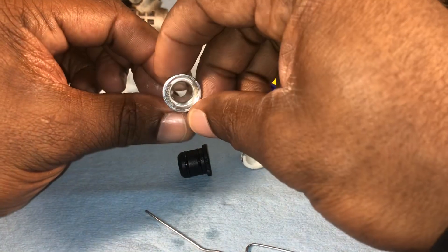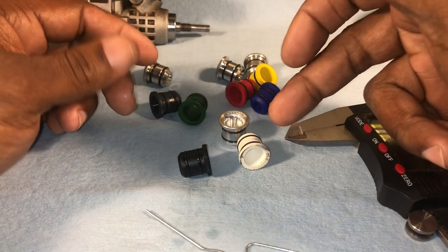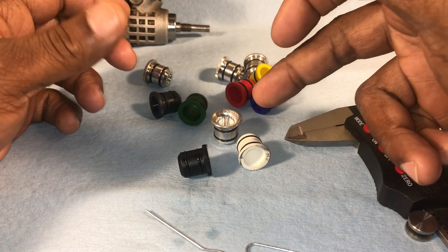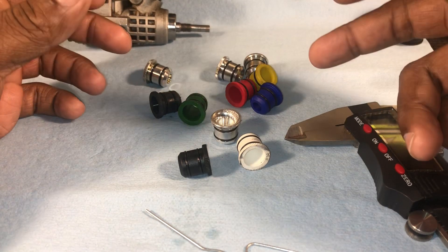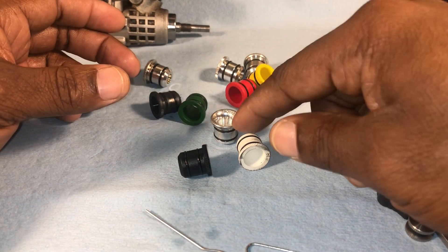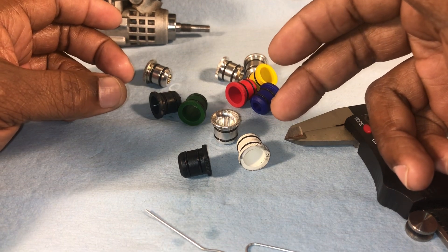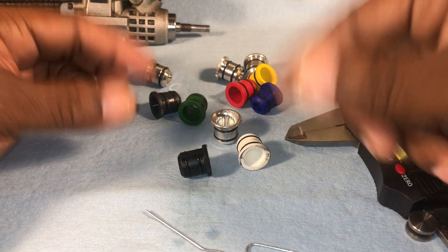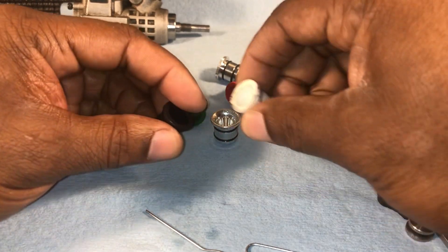There are different Venturi materials — like these aluminum ones from Novarossi. They're smoother. Honestly, I've never seen a difference between aluminum and plastic ones. Allegedly, aluminum is supposed to dissipate heat better. The aluminum ones come with the Mito line of engines, Rossi Venturis, and that new engine they have out. I've used both and never seen a difference.